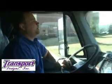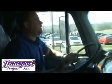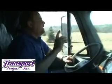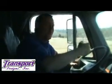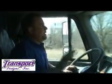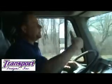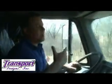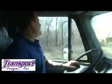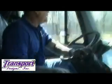The biggest thing to remember about chaining is it's just like backing up. You got to set it up right. If you don't set it up right, you're going to have problems. And what I mean by that is you're going to have to roll the vehicle forward. Remember, you're 70 feet long. So when you pull into an area to chain up and you're right up against somebody, you're going to have a serious issue. You're not going to be able to roll onto your iron, and I'll explain more about that when we get to where we're going.